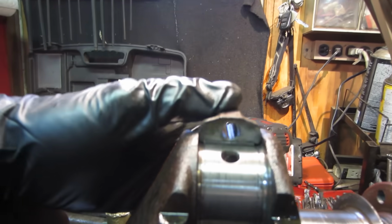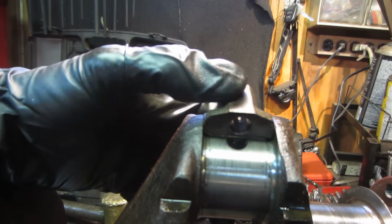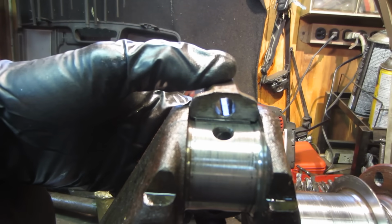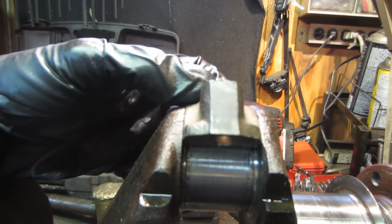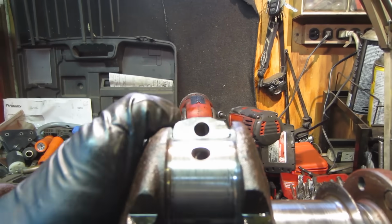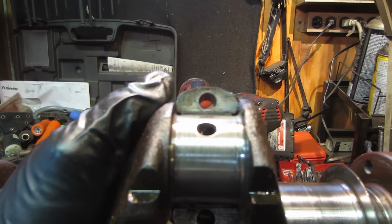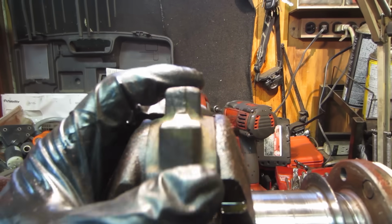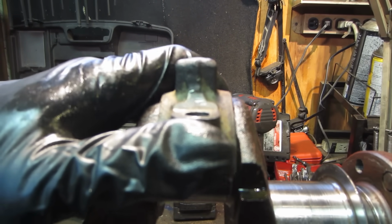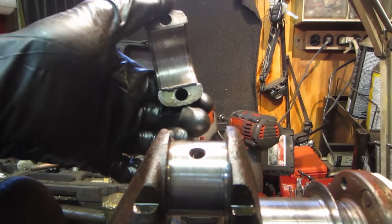But if it gets too bad over time, or your bearings start getting worn out, just getting sloppy over time, now they start getting a little too much play in them. And now the oil is just leaking out faster and faster, to the point where you'll end up not having any oil pressure. And it just will get to the point where it's going to either spin that bearing, you just spit out all the material. It usually gets real tight, and then it gets real loose. And then you get a rod knock, and the rod knock is going to be that play inside that circle no longer being able to maintain. So just wanted to kind of go over that.